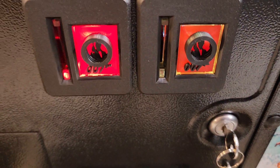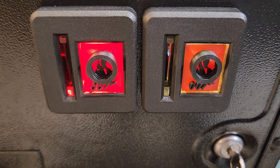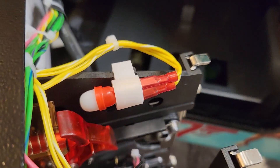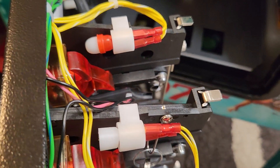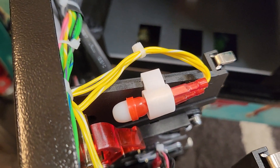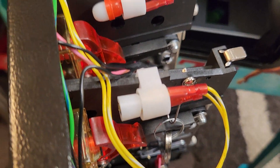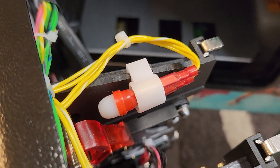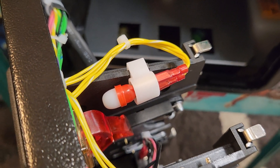Look at these two right here. The one on the right is the bulb they included, and the one on the left is a frosted bulb that I've installed. A frosted bulb is a better idea in this location because the frosted cover will help scatter the light more, and it's also a two or four diode bulb rather than just the single one they offer.